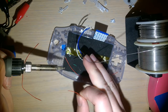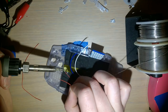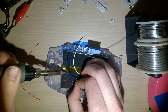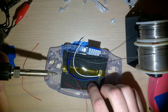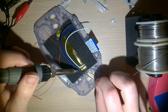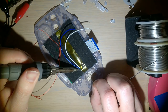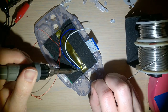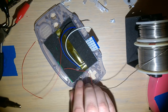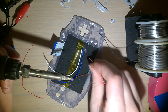And you know what? That's actually not that bad of an idea. Come on. These don't have to be too thick. Like I said, I'm using the 30 gauge Kynar solid core. These are only carrying a data signal, not 250 milliamps of power, so they'll be fine nice and thin. I don't like that these solder blobs are not shiny, but I think I'll get over it.